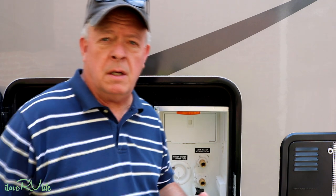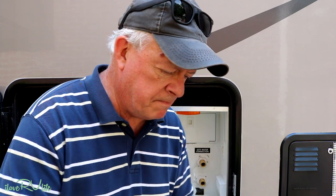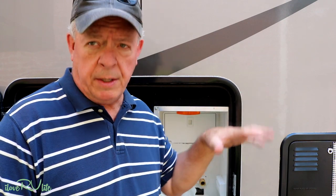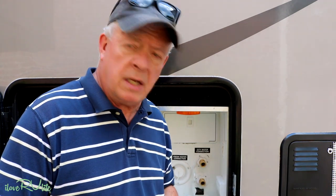The next thing is to check the water lines. We had a rough winter — cold cold cold — the pipes froze up once or twice, but only for a couple hours. The camper then sat for a couple months through tax season. Sometimes if you've stressed your pipes, things can happen. So I'm going to hook up the water line, put some pressure on the lines, then go inside and make sure everything is okay: under the sinks, toilet flushing, no leaks — those types of things.